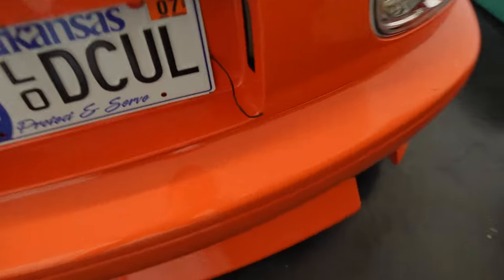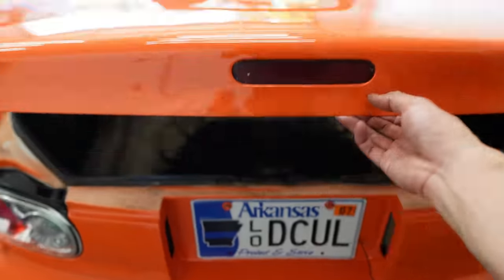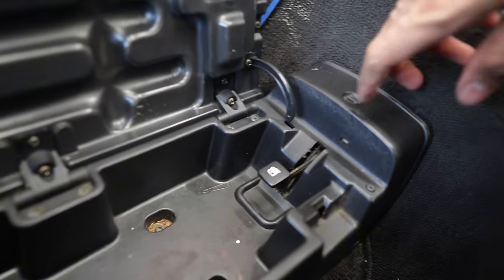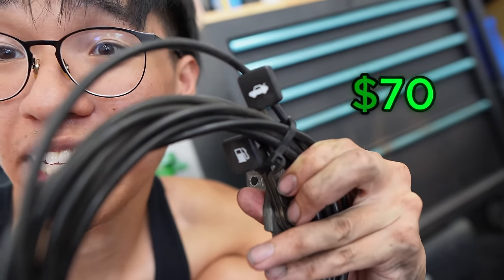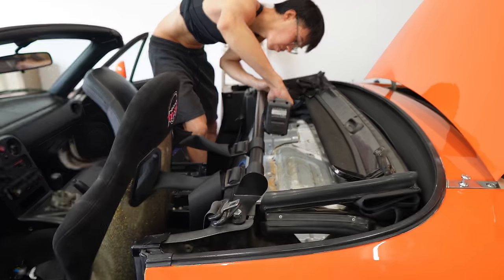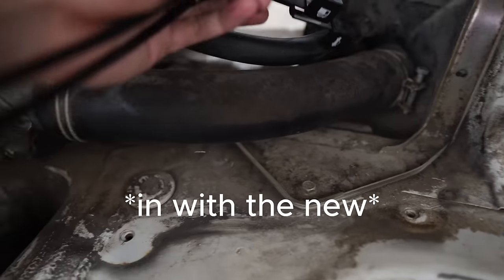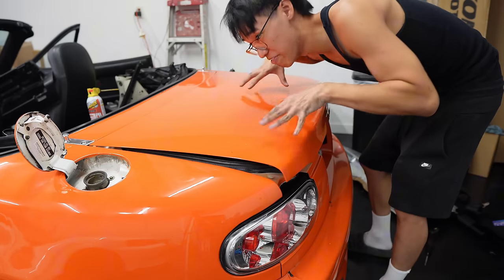There's a big problem with the Miata — basically the only way to open the trunk is by pulling on a wire. They literally rigged it up to where there's a wire behind this compartment, which is supposed to let you open the trunk. However, this is only the gas lever — there's no trunk lever. So I went online and ordered a different latch that has both the trunk release and gas. This is going to help a lot, make it more convenient and make the Miata a little bit less ratchet. Now we're going to take off the lever, and just like that, we got the old cable out. We can finally put this down.